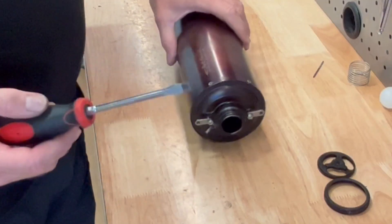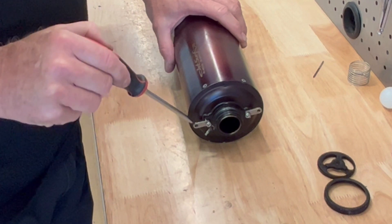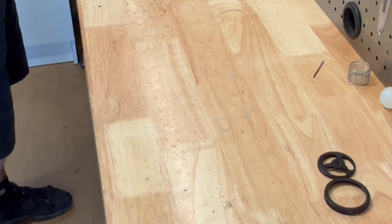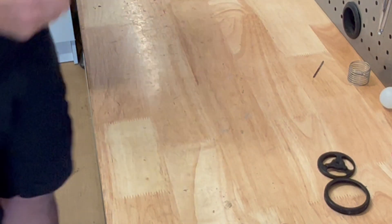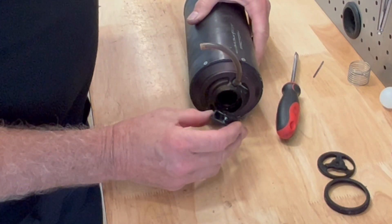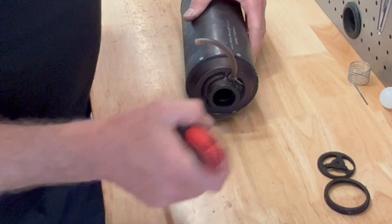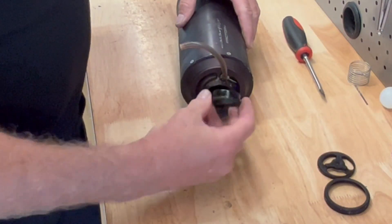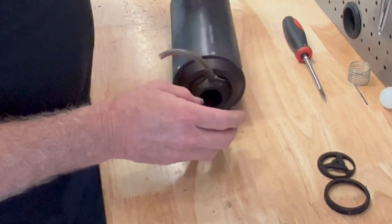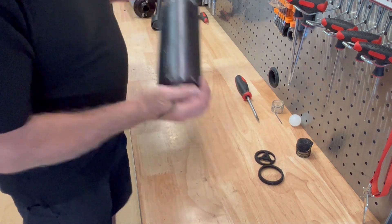I've got another pipe here from an earlier model to show you two different styles. You've got the one with the o-ring flange and two spring retainers that hold it onto the cylinder, and then there's the older style pipe which instead of o-rings has what I call a gum seal that just sits in there — the engine exhaust port slides into that. These gum seals are another failure point: they will melt and deteriorate. This older pipe is also leaking at the back end.